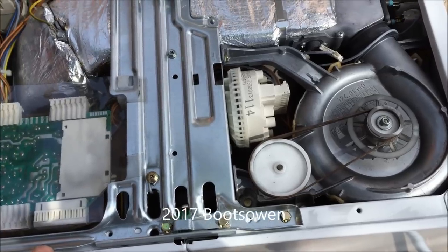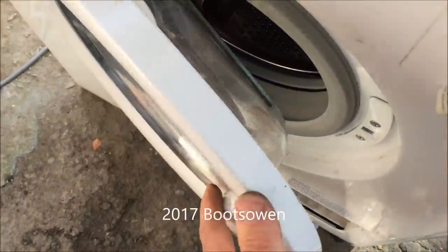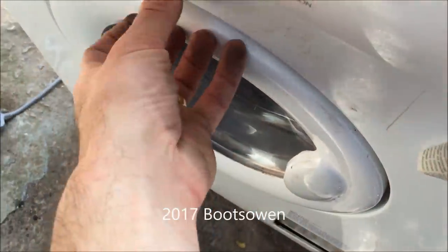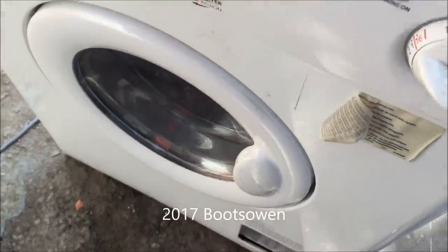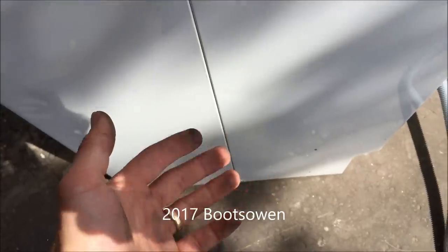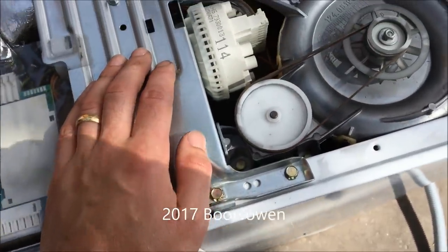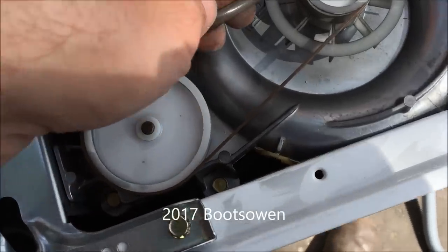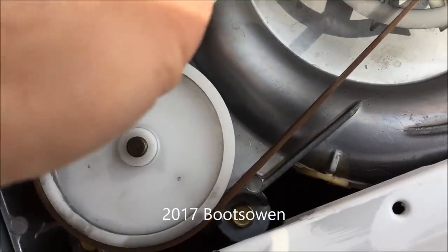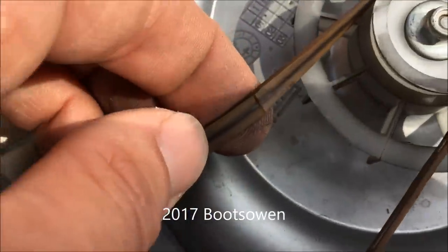So I've now got a machine that will wash laundry, but there are a few things wrong with it. One is the seal on the door — it's broken, and a new door seal could be quite expensive because it's a tumble dryer too with a blower fan coming down the top of that seal. The other thing is the suspension strut — the shock absorber is completely dead.